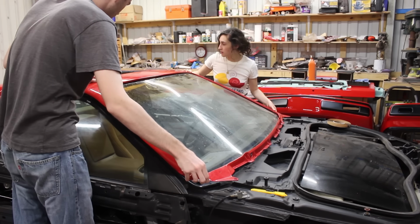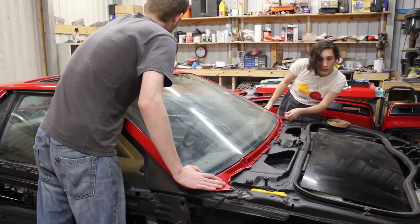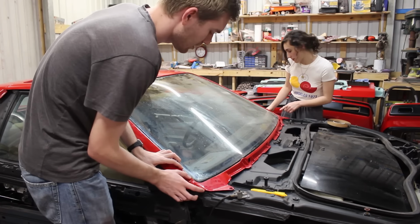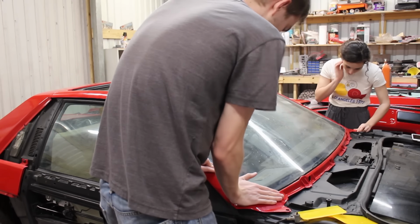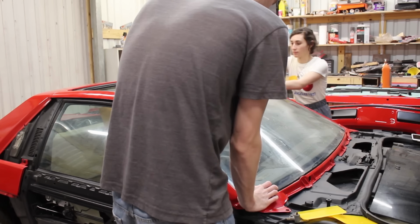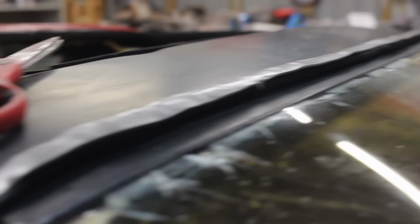Only problem is that 3/8 of an inch is on the other end of the not fitting spectrum, and is a little too thin this time. It really is always something with this car. The roof was really only making contact with the butyl on the top corners. I ended up doubling up the butyl on the A-pillars and adding a thin strip of regular butyl tape that can be found at a local hardware store on the top.